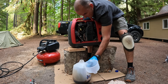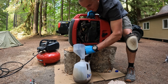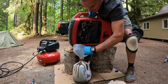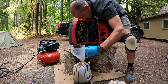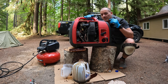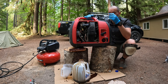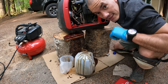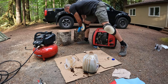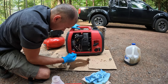What could go wrong? Oh — that could go wrong. Dang it, slipped my grip. Don't lie, that's happened to you before. Also something I forgot to mention: you're going to want to turn the dial on the gas cap to the off position so that when you tip the generator over, gas doesn't start spilling out from the top. All right, now you know how not to do that. Got everything cleaned off like nothing ever happened, all the oil is drained out — good thing I had that cardboard there.